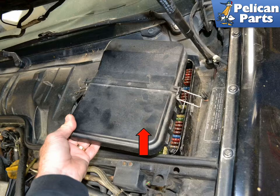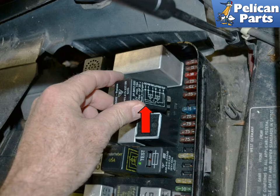To help decrease the pressure in the fuel rail, you'll want to remove the fuel pump relay and turn the engine over a couple of times until it runs out of fuel. Begin by locating the relay panel — in earlier cars it will be up under the dash; on later cars it will be in the rear left side of the engine bay by the base of the windshield. Remove the cover, check your manual, locate the fuel pump relay and remove it. Crank the ignition over a few times until the car sputters out of fuel. Fuel will still escape while performing this job, but this will help relieve some of the pressure.